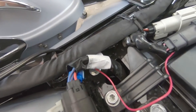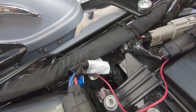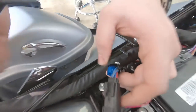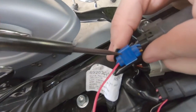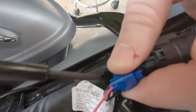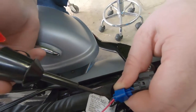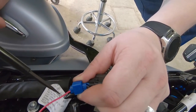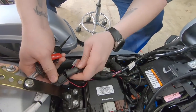After we did the left side, now you need to integrate your brake light. What you need to do is, in your wiring harness, find your rear lighting plug. Disconnect it — as you can see, we've already connected the wire tap. The one you're looking for on the 2020s is a blue wire with a purple stripe — that is your rear brake light. Simply attach your wire tap and your integrated brake wire, then plug it back in.